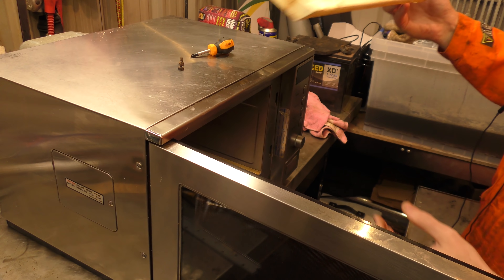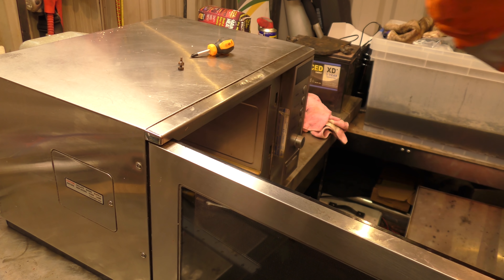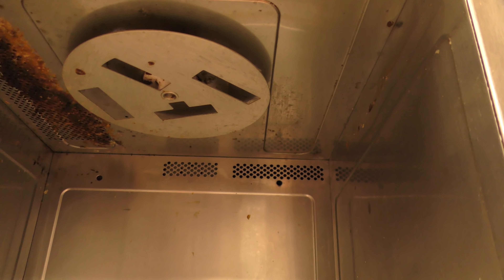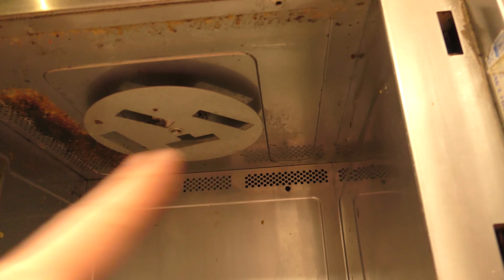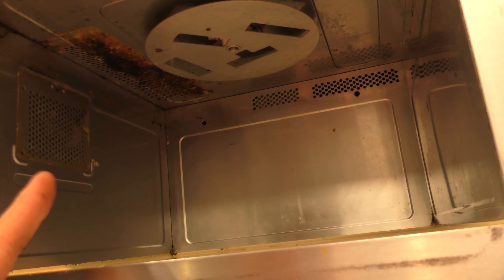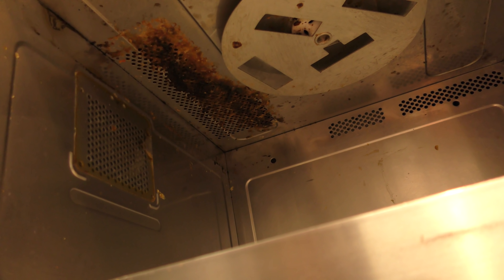Okay, so that bit just lifted straight out. Let me bring you inside for a peek. Now you'll have noticed on this microwave there's no turntable — it doesn't spin anything around. It uses a waveguide which actually reflects the microwave radiation around and keeps changing the direction, so it's the microwaves that actually rotate as opposed to the object. Well, that looks absolutely bogging up in there so we'll give that a clean in a minute. But let's get the rest of the outsides off. We'll start with this front grill.